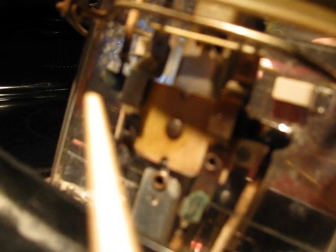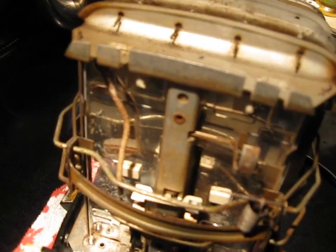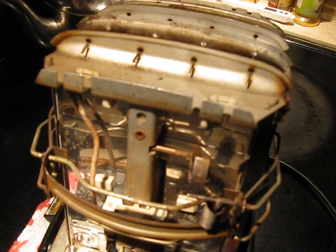So what we have is the electrical contacts here, and normally if your toaster is working correctly, when the trigger is depressed it functions like this. Now you can see this little strip right here — this is non-conductive, and that's going to be the key for how we are going to test one that isn't working properly, but which is capable of working where the electrical contacts are all correct but probably just the bi-metal strip is under too much pressure to work properly.